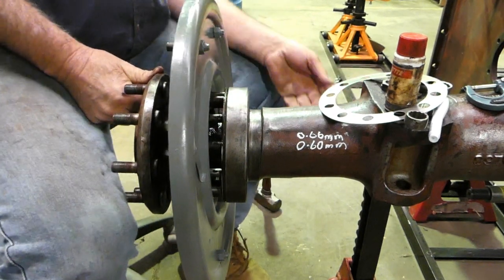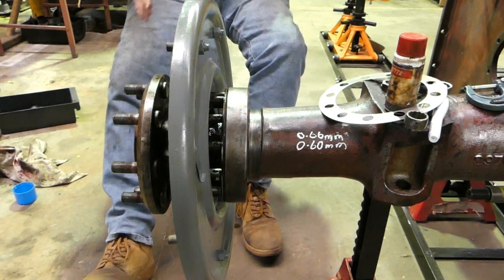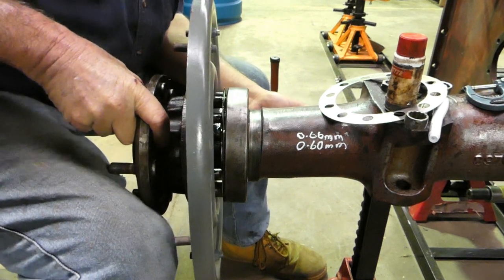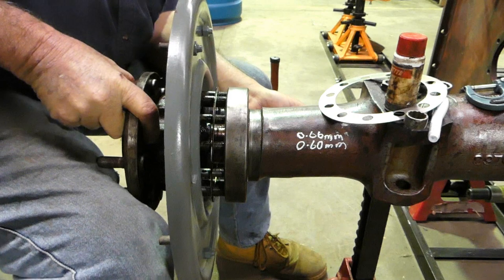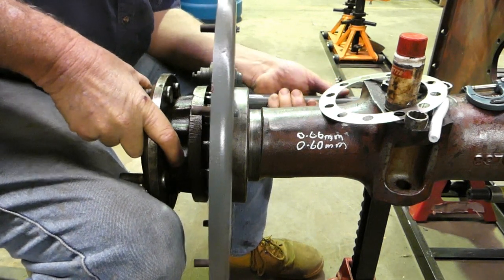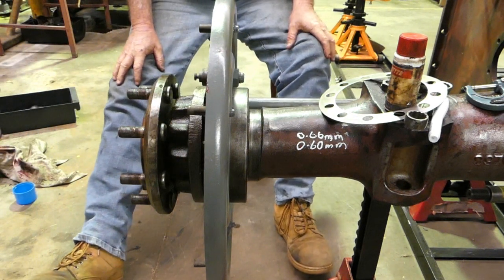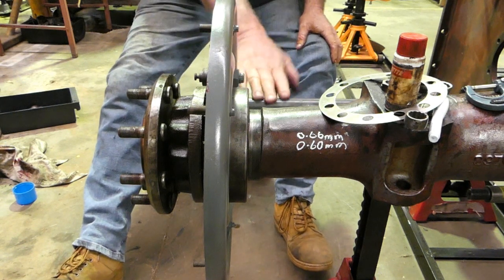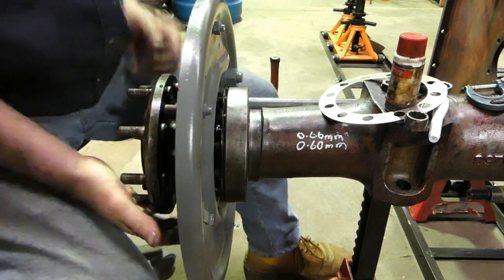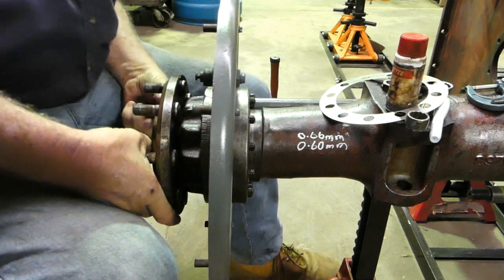Okay, now, I usually slide back here and just make sure that brake is even. Look, that's not. We have to come around one turn, or one bolt hole at least. And then if we slide out the front here for a look, that brake rod is sitting nice and parallel. So we should be able to bump this in now and give them a turn as it goes into the diff gears.